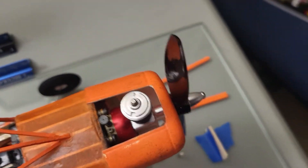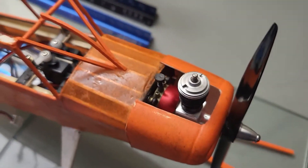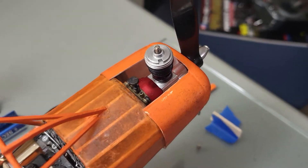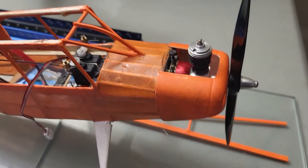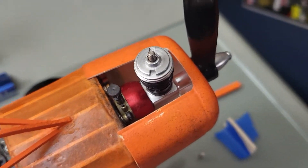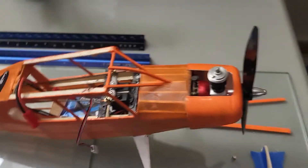If I'd gotten one of these used, I might as well have been asking for trouble. I don't know about these little tiny guys — if the needle valve gets gummed up or stuck, there's problems. These things are so primitive and simple as a two-stroke glow engine that there are many possibilities. The weight of it is about 26 to 26.5 grams without the fuel or propeller.